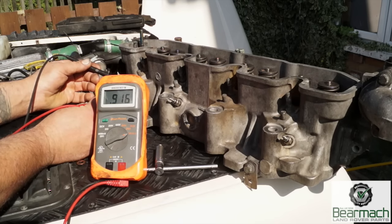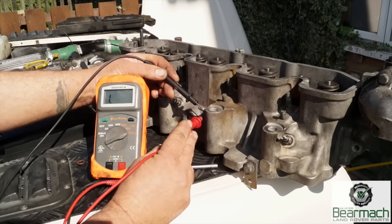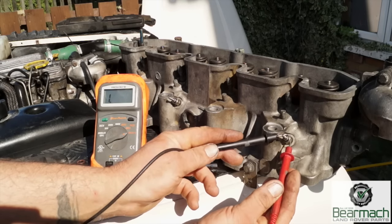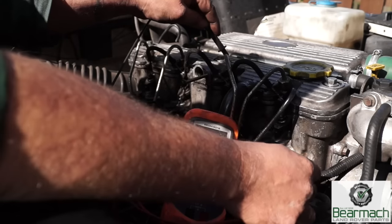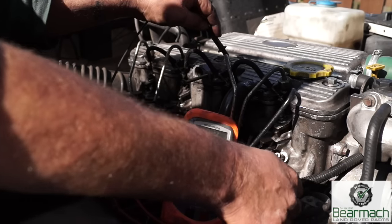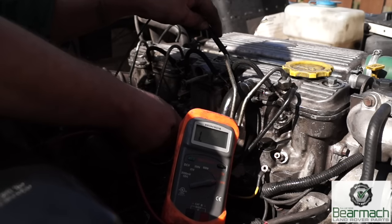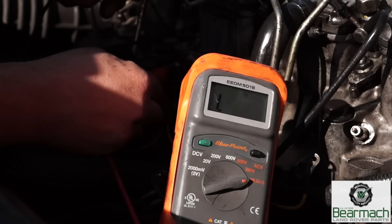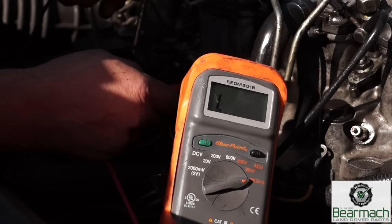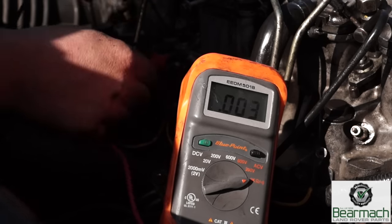Now I have a cylinder head here — that's an acceptable reading. However, this one, this one, and number one on this head means three of the glow plugs are dead. Going on to our engine here, I'm checking these out as well, the same way — tip of the glow plug using the engine as an earth. You can see that I actually don't have a reading on number two glow plug. Number three glow plug — fine resistance. And number four. Going back to number two, there is no reading there whatsoever. So basically we have a dead glow plug. This is all you need to do to check them.